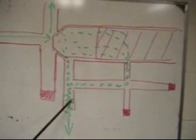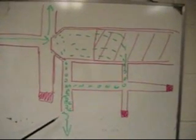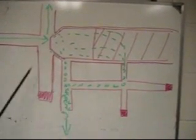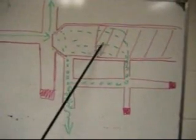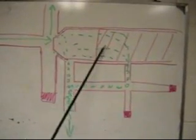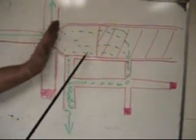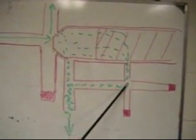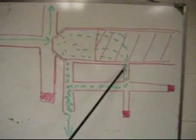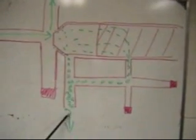Sometimes if the valve is jammed, or the machine shop has accidentally blocked this line up here, we'll see the oil pressure go up to about 100 pounds before it blows the filter apart. Now the oil that gets past the oil pressure relief valve comes in back here behind the chain, and where there's no vent, it would fill with oil back here, lock this valve up, and the valve couldn't push back, and the oil pressure would skyrocket again. So there's a little bleed here at the back of the oil pressure relief valve that allows the oil to get past the valve and drop back in.